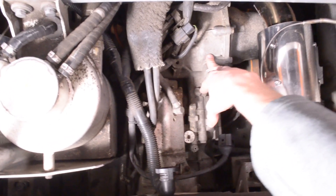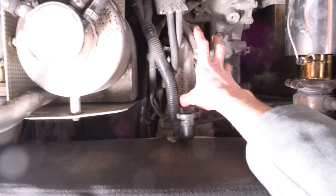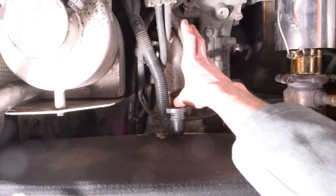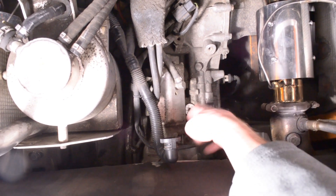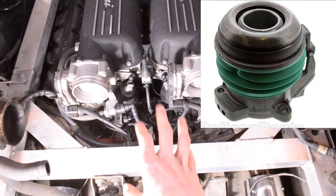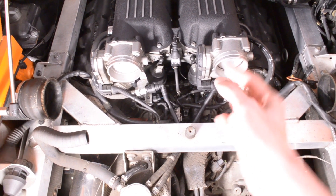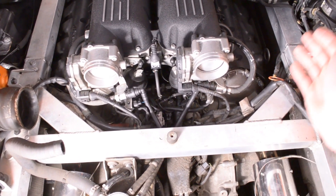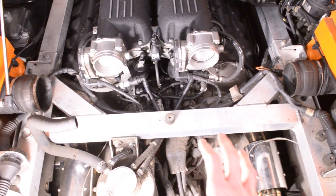And this is the Graziano six-speed manual transmission. The two systems are completely independent in terms of fluid. You can actually unbolt this whole entire actuator and remove it from the car — there's no sort of fluid coupling whatsoever when it comes to the actuators that actually shift your car. So if you have a manual transmission, you're going to have a set of two shift cables coming to this area and a set of actuators that actuate the transmission. That is inherently the only difference between a manual and an e-gear. The e-gear system also electrohydraulically actuates the clutch slave cylinder, and it's controlled by a computer. So other than the slave cylinder to actuate your clutch, the e-gear fluid and the transmission fluid are completely separate systems.